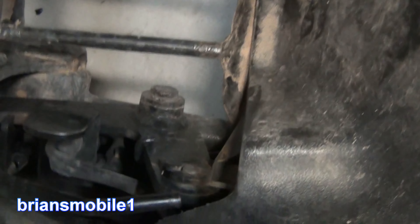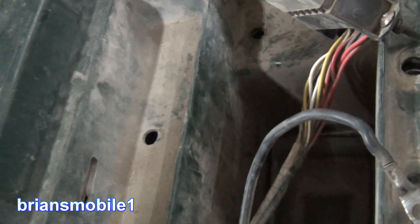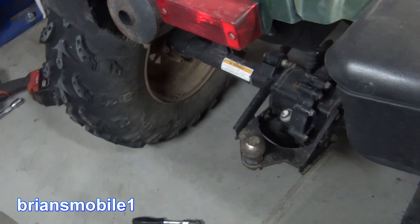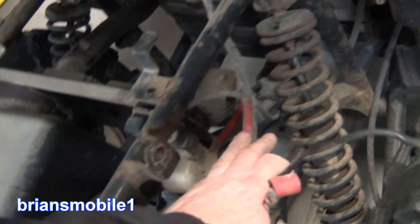I've got everything undone except for this one stripped out, and other than that it should come off. You've got to unhook it from around the brake on the back side. I've got the T30 Torx — that's the one you want. Let's see if we can just tip this thing up out of the way. If they had strategic holes where the bolts are for this rectifier, this would be a lot easier — I may look into doing that because I may have to do it a few times. Given I'm going to be using a cheap one, I'm spending about 30 dollars, not 300.